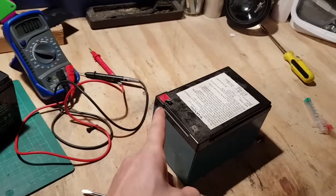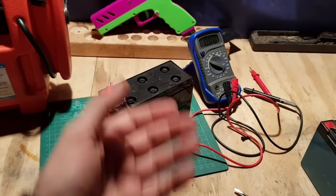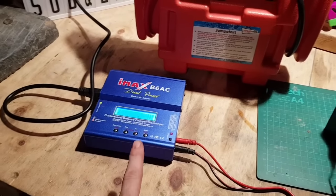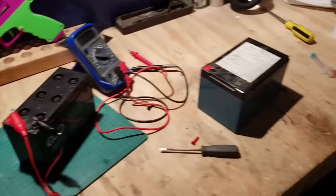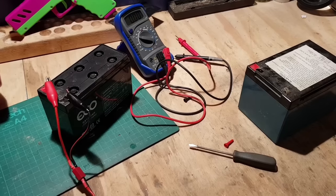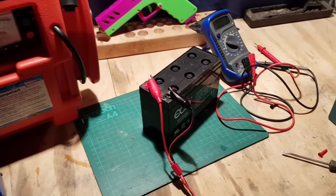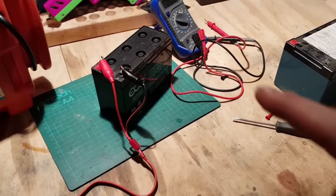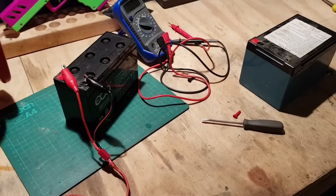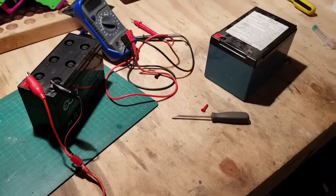That's how you trick a smart charger into charging your stuff. All I used was a jump start pack, but you could use another similar battery — just link wires from red to red, black to black, and let the power seep and trickle over into the flat battery, boosting the voltage up and tricking the smart charger into working. I've still got to do another two batteries to get the electric bike going — that should be a doddle. Rather than buying new ones, this is how you recover them. Good luck, and if this helps you in any way, please leave a thumbs up or come back and give us a comment. Bye for now guys.